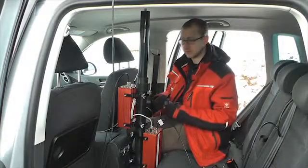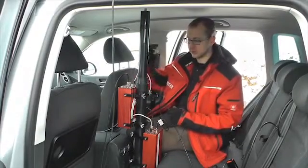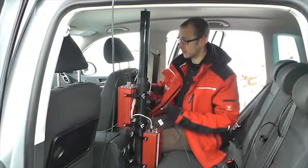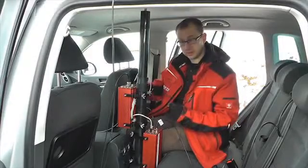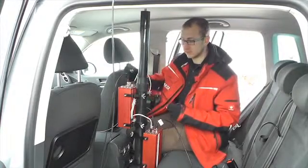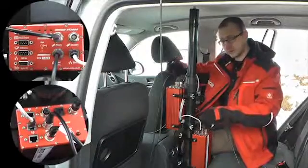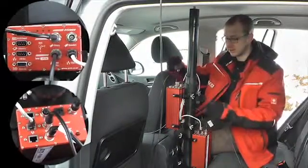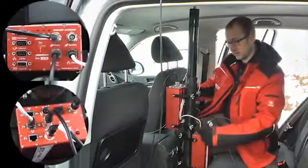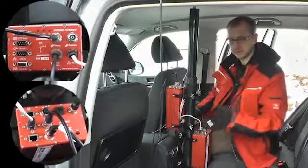In the target vehicle, this one has an RT2000 model as opposed to the RT3000 in the Hunter vehicle. Where the RT3000 has a user cable with all the connections coming off the cable, this one has separate connectors on the front panel. To power this through the target, you use an M12 to M12 connector included with the RT Range system. Insert the connectors and screw them down securely so they don't come loose during use. The separate ethernet connector connects from the ethernet port on the RT2000 to any of the three connectors on the front of the target box — it doesn't matter which one.